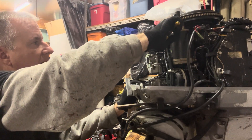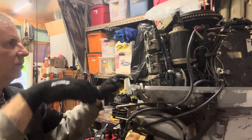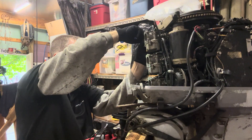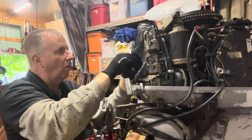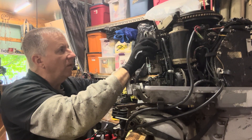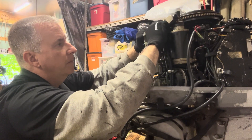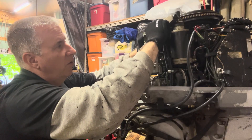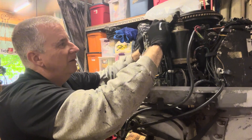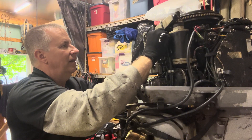This is the one I put a new tie strap on, so it's going to be tighter. But look at the end of that fuel line — it's kind of crummy, so I'm going to go ahead and replace that. We'll start with the top carburetor, get it on the bench, and see what it looks like when we pull that bowl off. The carburetor is kind of loose — usually if it's been on there for a long period of time the gasket will stick, so it feels like it's been apart before. I'm going to take a jar and dump this fuel into it. Also, there should be lock washers on here that are not on here. Parts sourcing-wise, I prefer ProMarine down in Florida, but sometimes Boats.net can get it here a little faster, and let's face it, I'm not a very patient person — when I need parts, I want to get stuff done.